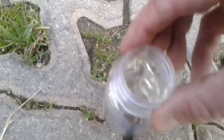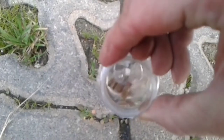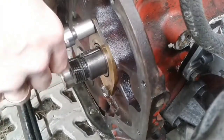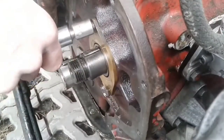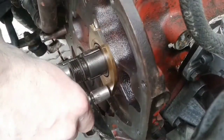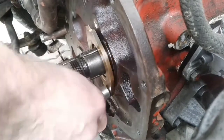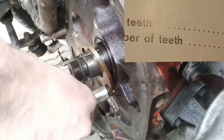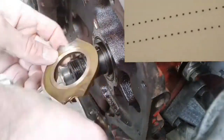Only kerosene or compressed air can be used to clean the oil jet. The bronze plate is broken and must be replaced. Bronze is a very soft metal, and now only steel thrust plates are sold. If the plate is not broken, it can simply be installed inside-out.